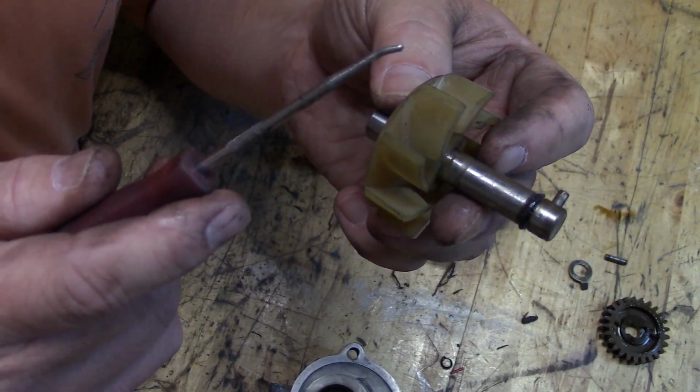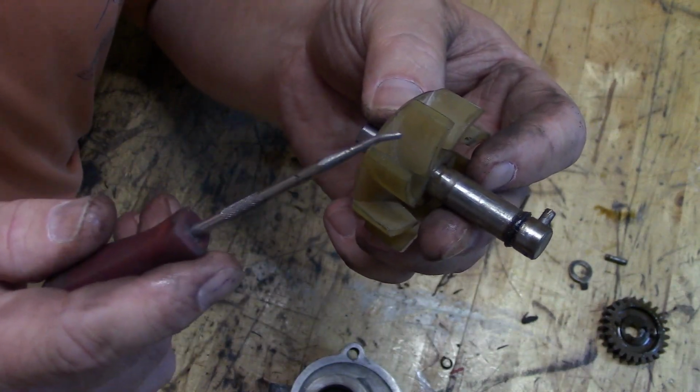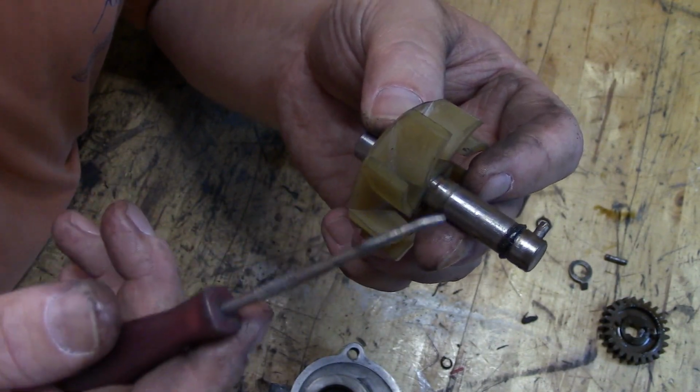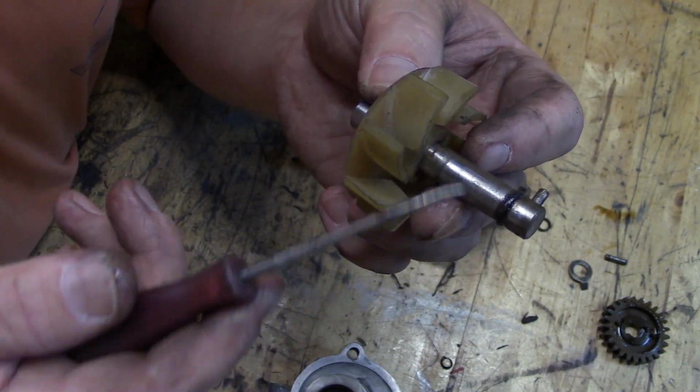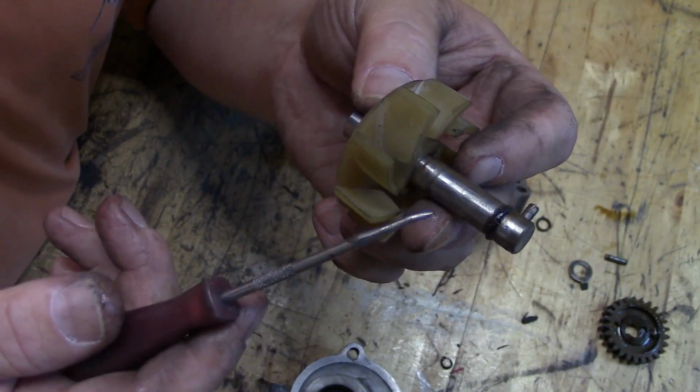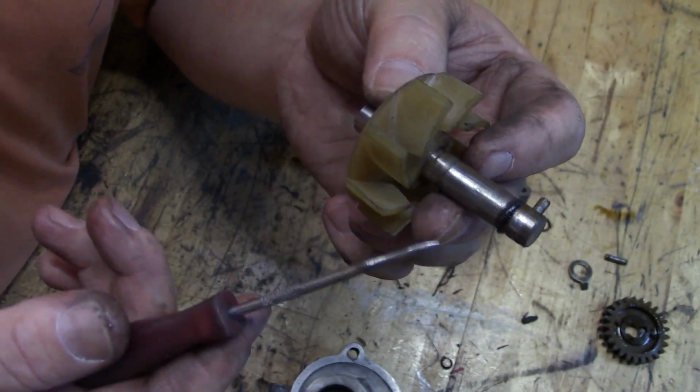I noticed a minute ago when I was draining out my coolant that it looked kind of milky. The coolant looked milky, not the oil. The oil looks fine. You would figure it'd be the other way around, that if oil and water were mixed, the oil would get a milky haze. But the oil is beautiful. It's clear and nice.